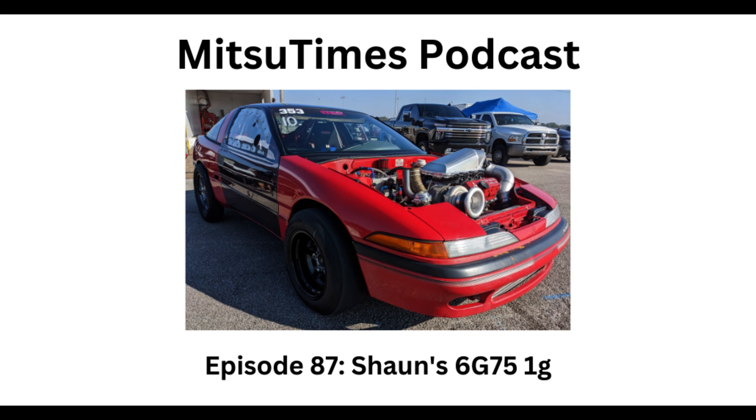I've never played with all-motor so I'm pretty excited. We're getting cage work done now - we were hoping to have it done before the Shootout but it wasn't to be. Going 9.5, I should already have a 10-point in it - right now it only has a five-point roll bar, which is good for 10.0 per NHRA. We're deciding whether to do a 25.5 or a 10-point, whether to pay somebody or do it myself. I've got the bender, but the dies are expensive. If it's not something you've got a lot of experience with, it's easy to junk a whole stick of chrome-moly.